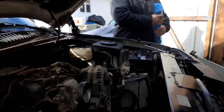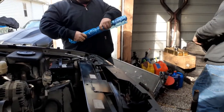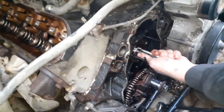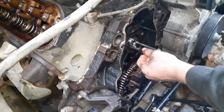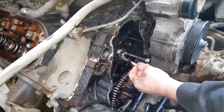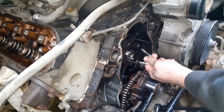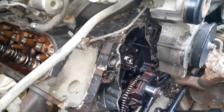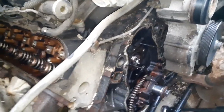We're going to lube the other one up real good and stab it back in there the same way. The new cam is in - Truck Norris. That worked out pretty good. We didn't check them cam bearings though. We're not going to change them anyway. We didn't hear anything fall, so I'm confident all our lifters are still where they should be, but we'll know for sure when we put the pushrods back in.